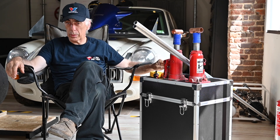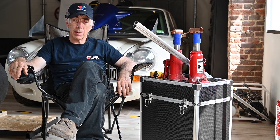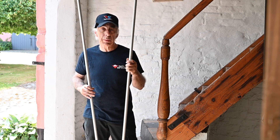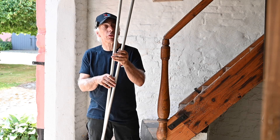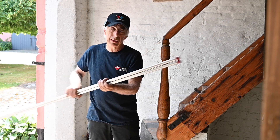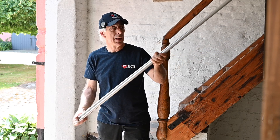You're going to need at least two tubes that are wider than the track width of your car. If your car is one meter fifty wide, go for two-meter tubes. I have gone for two-meter tubes as you can see here. These tubes have to be of exactly the same length — keep that in mind, because if they are different your measurements will be off.